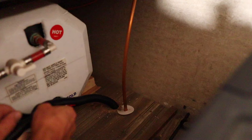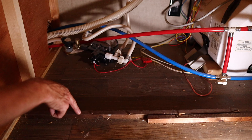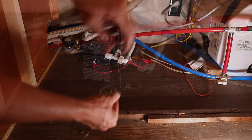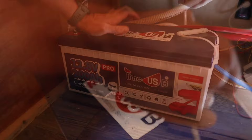With the wires up inside the trailer, it's easiest to get them a little bit out of the loom so you can pull them the rest of the way through. The spot I've selected for the battery is right here — it's a big open spot and normally there's a piece of wood here that prevents things from coming in, so we'll use that trim piece to help hold the battery in place. I'm using d-rings screwed to the floor and then running a strap over the top of the battery to secure it.